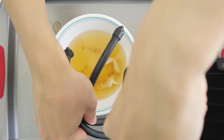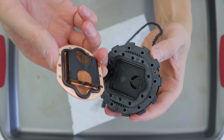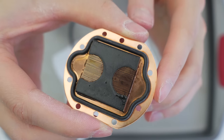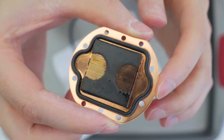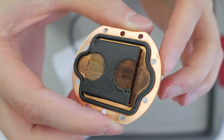After removing several screws from the bottom of the head, we can remove the cold plate. The cold plate is a solid piece of copper that has direct contact with the CPU on one side and several micro fins on the other side for liquid to flow through. You can see on my unit that a large amount of the debris seen earlier has clogged up this area.